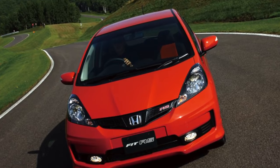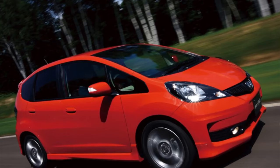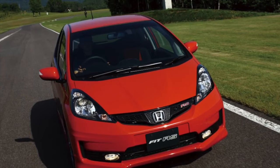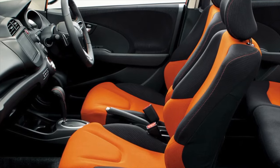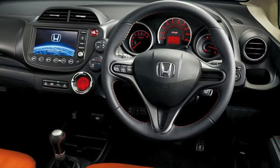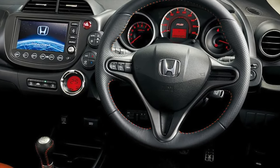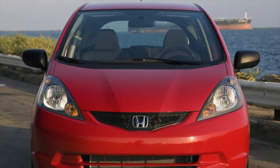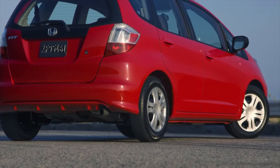On the bottom of the car, the presence of significant pockets of rust should not be there, although the seams are prone to corrosion. Among other shortcomings, it is worth noting the weak front optics and fog lights, which are not famous for either quality of light or reliability. In the headlights, in addition to the weak protective plastic that scratches, the lamp connectors can melt during prolonged use. There are also complaints about the quality of the fastening of bumpers and rear-view mirrors, which loosen up over time. On older specimens, the wiper trapezium requires tensioning and the bushings break. The door seals are also of mediocre quality.